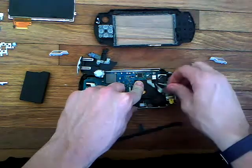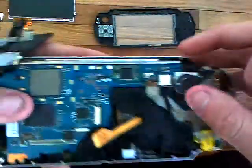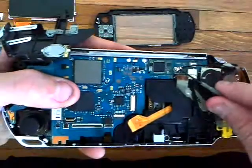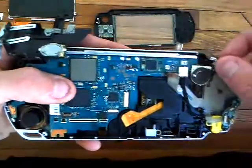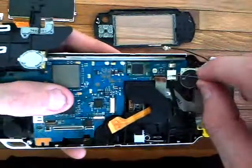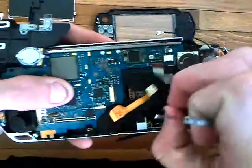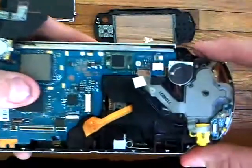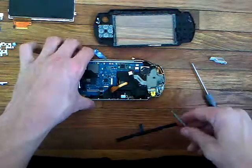Over here there's also one piece you have to move up — very easy — this is for your directional buttons. This piece right here is the more complicated part — it's for a couple other things. You might want to get your screwdriver under there to take it up; it's kind of hard with your fingernails. Then this one right here is for the charger — stick your flat head screwdriver in there, twist it to get a gap, and pull on the wire. That's for the charger right there.